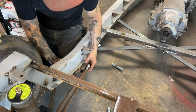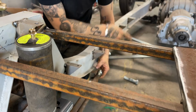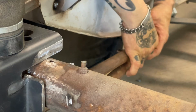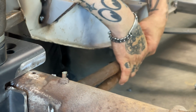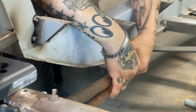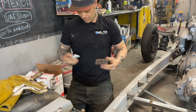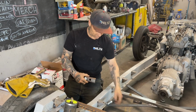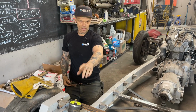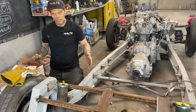And that would have to be gusseted from here on the bottom of the chassis, just like I did the transmission mount. I'd put a piece on there and 45 it up to the frame to hold it in place. I think what I'm going to do is nail that on there. I got to dig that hole out a little bit, unless that bolt doesn't fit. I'll put the bolt through this and put it through that heim joint. I'm going to place that where I want. I'm going to drill some holes in this, tack that on, and then we'll basically be mocked up somewhat.